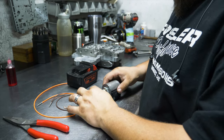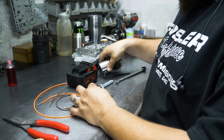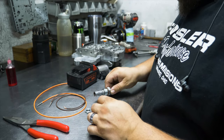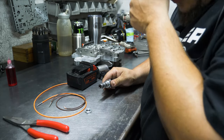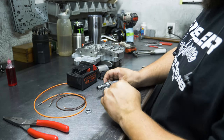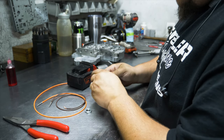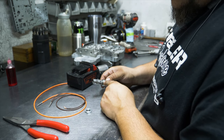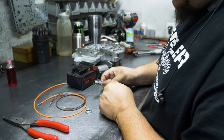So I thought, okay, I have an issue. I've never had this apart before, so I kind of started trying to figure things out. The coil comes off very easily just with a nut on the back. So this is the coil that energizes it that moves the valve. And then we tried to take an Allen wrench to push on the valve here in the end and it wouldn't really want to move. So I tried to figure out how this thing came apart, didn't really know how at first, and then I thought that it probably unthreads right here. Got lucky. Carl ended up calling me for another reason after hours and I was able to ask him how this comes apart, and he told me how it came apart.